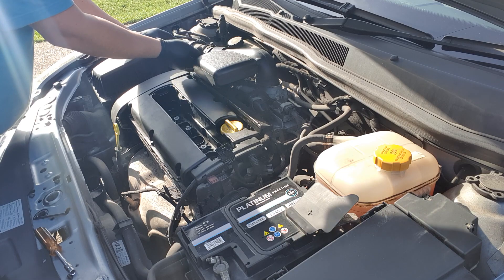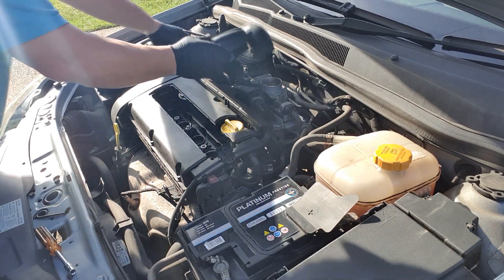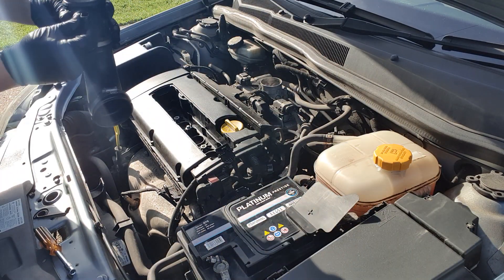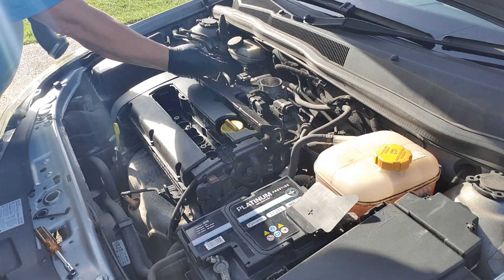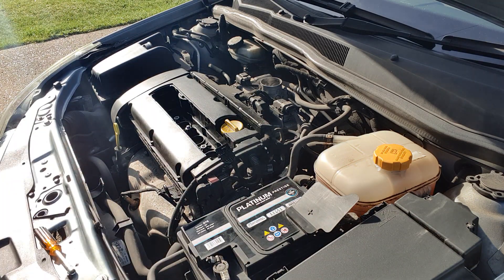There's a little plug that needs to be unplugged — a little connector on the mass airflow sensor. It's got a similar clip to the one we saw on the coil pack. That's the mass airflow sensor where the plug plugs into. Once that's removed, put it somewhere safe. Next thing to do is to take off the upper timing belt cover.